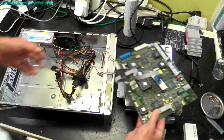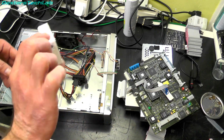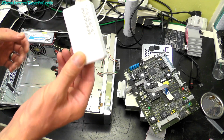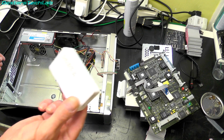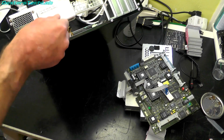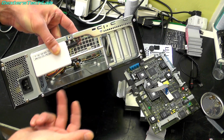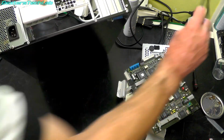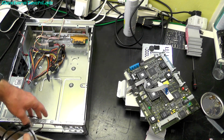So what I'm doing, I'm actually going to install this really tiny little network switch. This is just a really cheap 10/100 switch, and that runs on 5 volts. So this is going to get powered up permanently off the standby 5 volts, and that will just plug in at the back. It'll just mount up here. We've got a barrel plug wired in, so that can go into there, and then I have a short right angled network cable just here, and that will plug into here and then plug into the Netcom. So that will solve that issue.